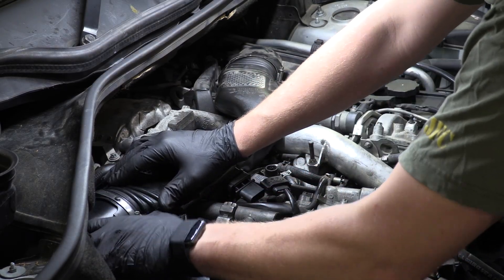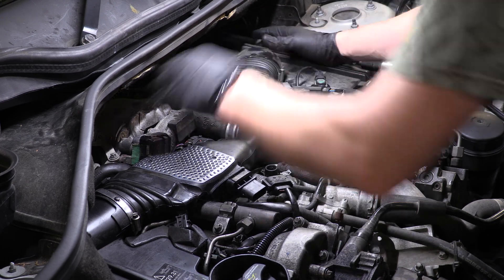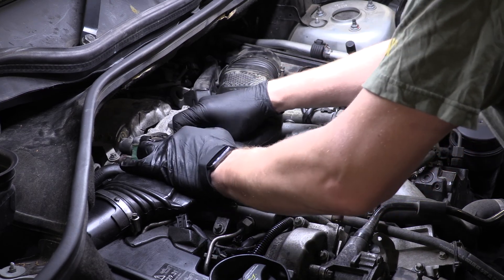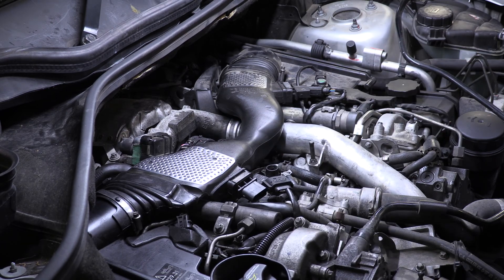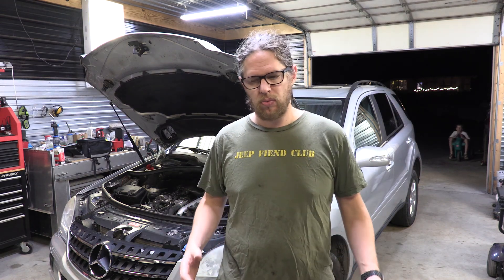Putting the batwing back in, taking it for a spin to check that all the power is good. Even with a glow plug that isn't quite functioning right, the car should run pretty well — especially in these temperatures, about 70 degrees outside. That took care of it! I drove around the block and the swirl motor code is gone. I still have the glow plug code — we'll deal with that on another day. Thanks for stopping by — like, subscribe, and if you're already subscribed, don't leave. See you guys on the next one.